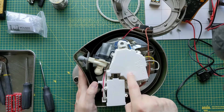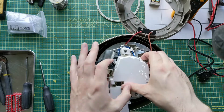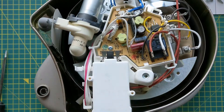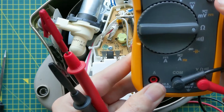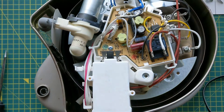Now we need to get into this box. There are actually four plastic tabs we just need to pop open. Last time I was in here I checked the relay — I got a multimeter, set it to ohms, and clamped it onto the terminals of the relay.